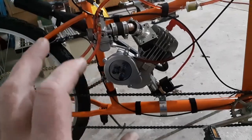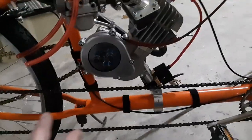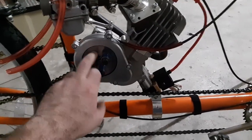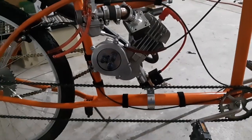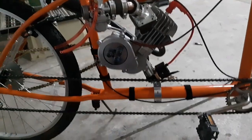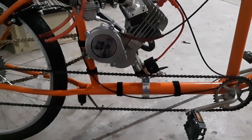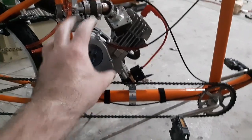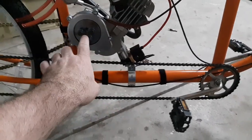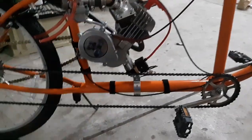The biggest problems I'm having, two of them are major with this thing. One is I got the green pads in here. I had to put a steel disc and everything in this because I was having a lot of problems with the clutch. It'll actually smoke the green pad. So I got a full disc in there of green pads, and if you give it gas, it will not grip. And no matter how tight, I mean, those are as compressed as I can go. I had to upgrade the bolts even just because of that reason.